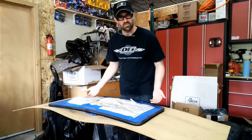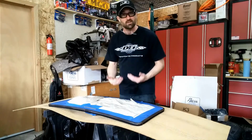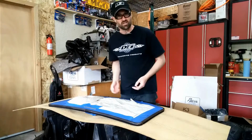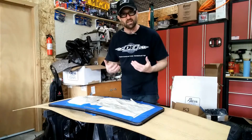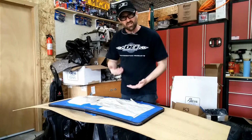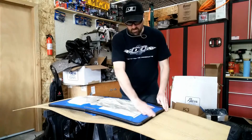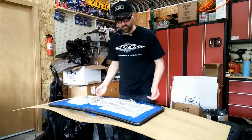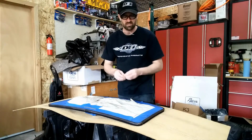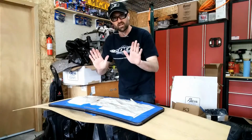So once the seal is out, you can start sanding inside the channel. Now I did have some surface rust in there, so I just used some 220 grit sandpaper and just double folded it over so it took up the channel, and I just scuffed as much of the rust out of there as I could. Got it down to a pretty good comfortable level on it, and then I used the same rust inhibitor I had been using inside the car itself. So now the channel itself is sanded and rust inhibited, and it'll be good for another, hopefully, 30 years. The outside piece has also been sanded with the same 220. I've cleaned it off, and I've cleaned the edge all the way around and on the top with just some basic glass cleaner, taking off any of the rust inhibitor that I had sprayed around the edge. So now this is clean, just like that, you can see.